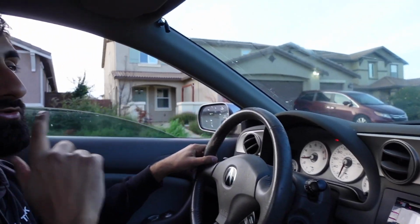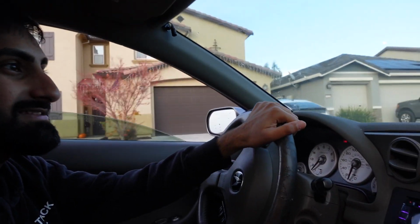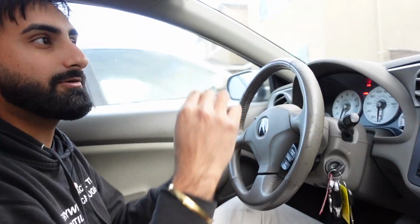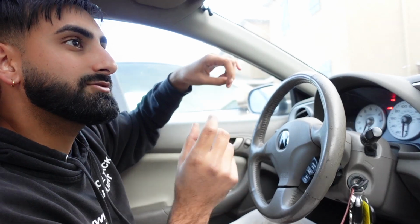I think what I'm gonna do now is I might just raise the car a little bit, because even if I had that piece cut off, oh yeah, you guys hear that? Even if I had that piece cut off, I would still think it would still rub. So I have decided I'm gonna just raise the car by maybe a few millimeters, and with that, it will not have the tire rub. I think it's from the inside of the tire. The tire is too thick that it's hitting the back end of the fender.